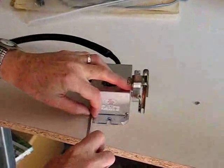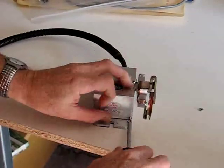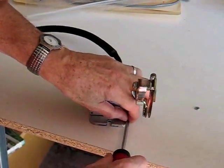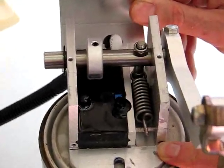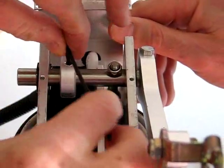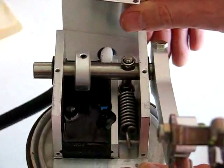This is the potentiometer box, which is basically the electric accelerator. Eric's taking it apart because it's got too much free play before it starts to apply any current voltage. This is inside the 96-volt pot box for this Chinese kit, and there's just a little adjustable big washer with a magnet on it.